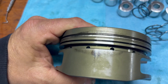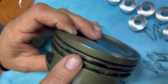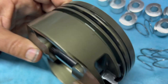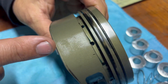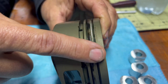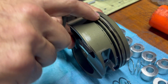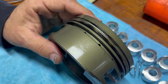If you look, you're seeing the hard anodizing has worn off of the piston right below the top ring land, about 90 degrees off from the wrist pin. I've never seen it wear here and not on the skirt. A lot of people know it's common knowledge that if you're getting issues up here, it's probably your tune-up — it could be a fueling or timing issue. And I agree with that. But when you don't have scuffing on the skirt and you just have scuffing below the top ring land, that's something I've never seen before.